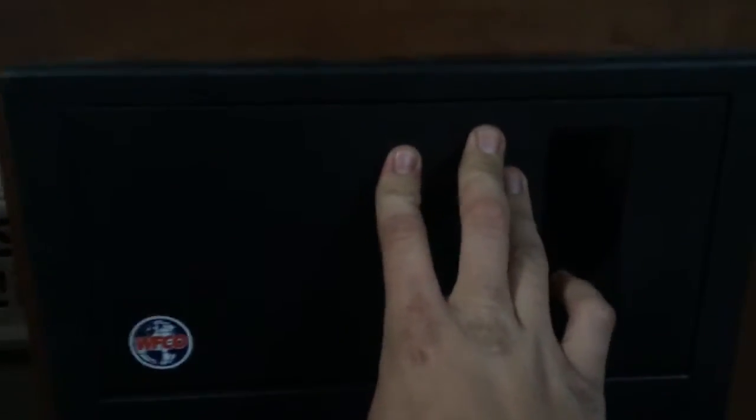So this is my personal travel trailer. I'm going to show you where the converter is — on a lot of travel trailers you're going to find your 12 volt fuses here. I'm inside a Coleman travel trailer and obviously that's the refrigerator. When I ask people where their 12 volt fuses are and they tell me they don't know, a lot of times you'll find them inside the converter box.